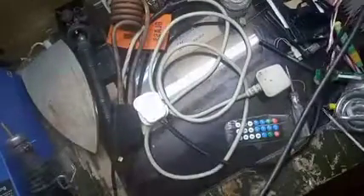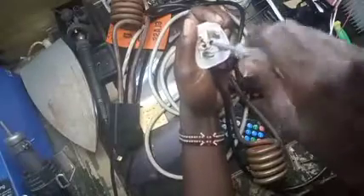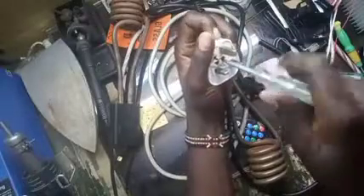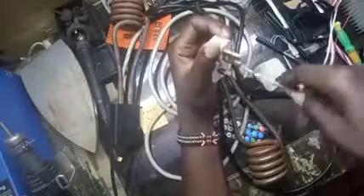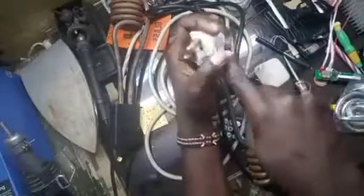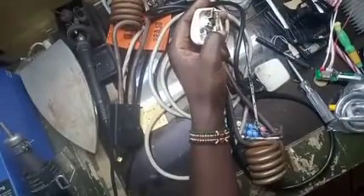This fault is caused by the cable length. As you can see, the cable length is so long. The client, after buying this water heater, decided to increase the length of the wire without knowing that increasing the length of the wire will also increase the resistance. When the resistance is high and the wires are weak, they end up burning everything around them. The fuse got burned along with the plug.